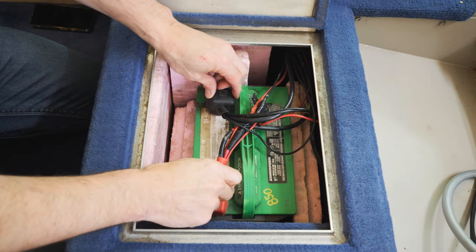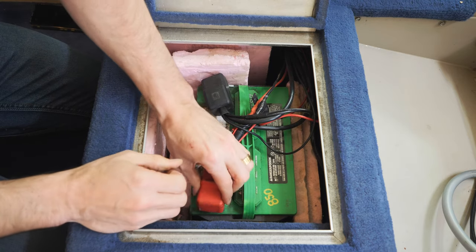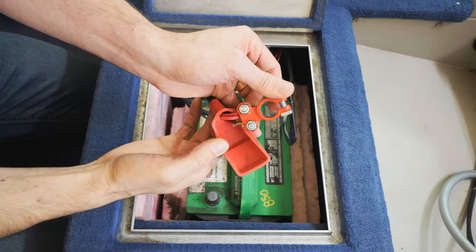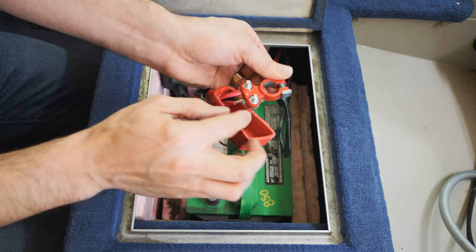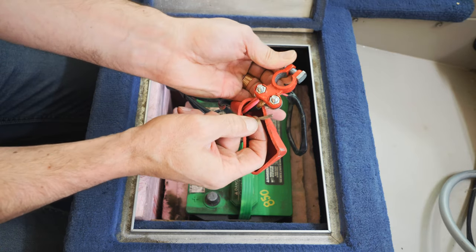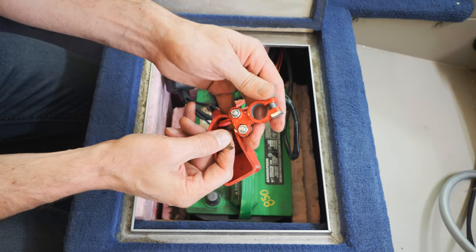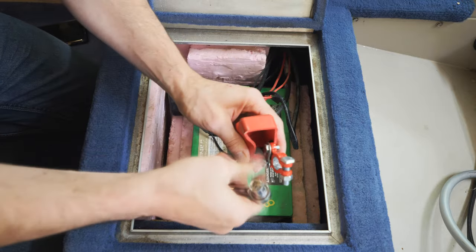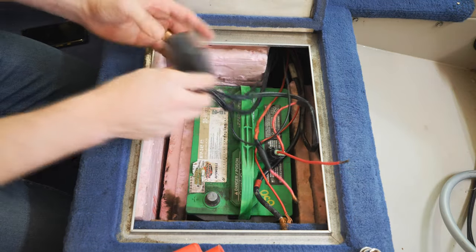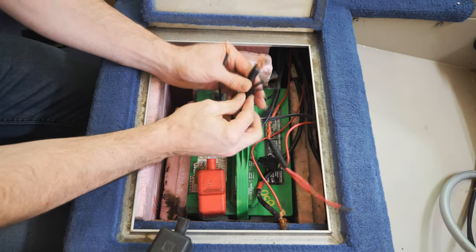So here you can see my setup — we've got the terminal covers protecting the battery posts. We're going to take these off and get to these wires. Because it's on here so tight, it's impossible for me to get at anything. So we're going to unscrew and unbolt these right off the posts. You can see the current connector I was using — it's just two bolts with a plate that tightens here and all the wires just get shoved inside. And now that I'm taking it apart, you can actually see this wire just popped right out. So you can see this is not a great solution — that's why I never showed it. I wanted to try it out to see if it would last a year. It did, but by the looks of this...